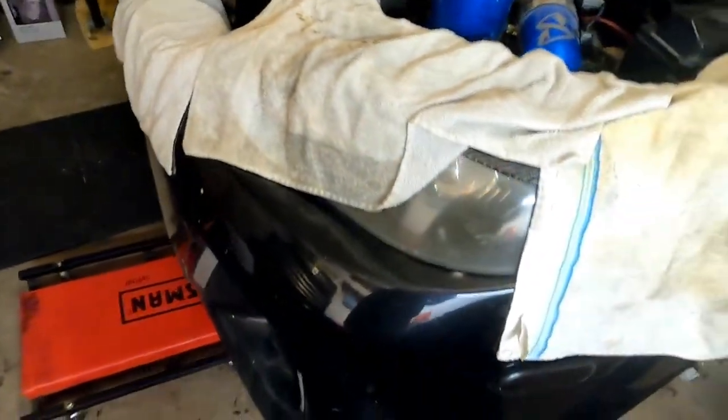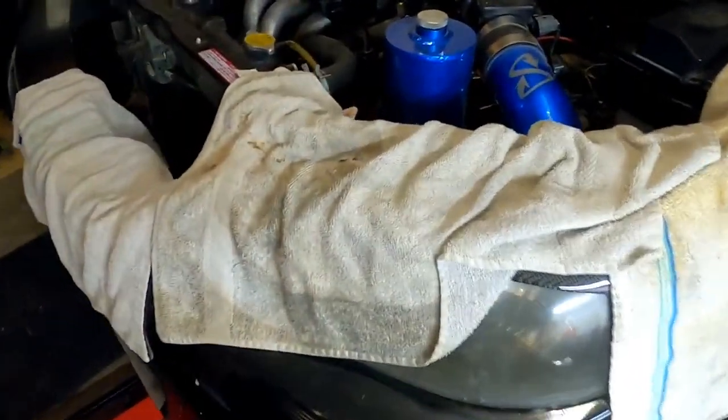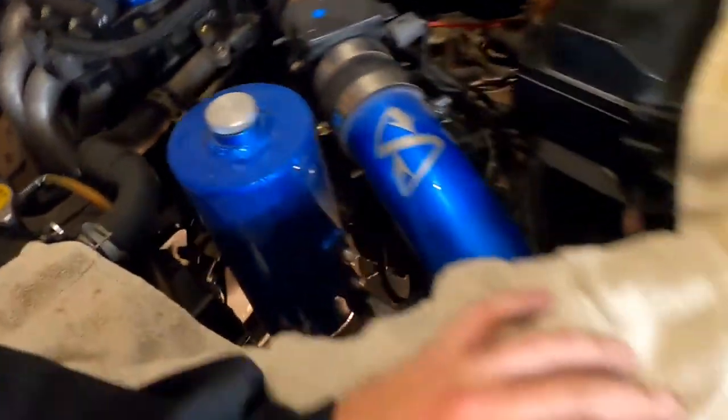So, we're gonna break all this crap loose. Again, I've gotta finish getting this out. I'll pull this bumper off, because it needs work other than just our job here today. And I guess we'll cut back to figuring this nonsense out down here. If I remember where I'm at, I think we need a pickle fork on that ball joint down there. We can bump that strut loose. And I think with the ball joint and the strut, we can pull that axle out enough.